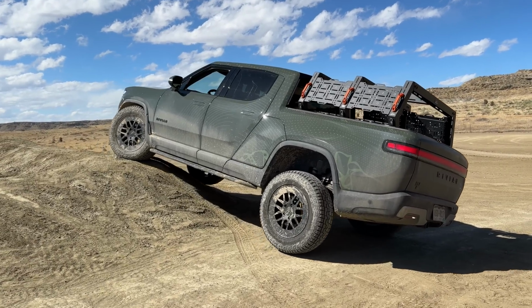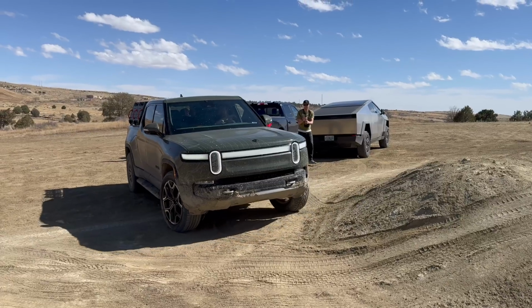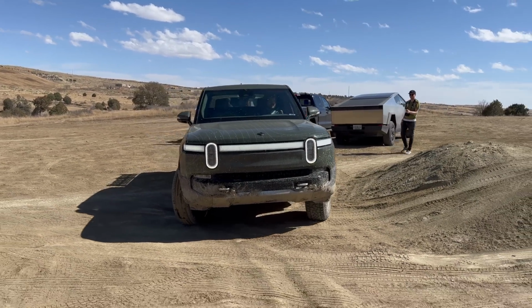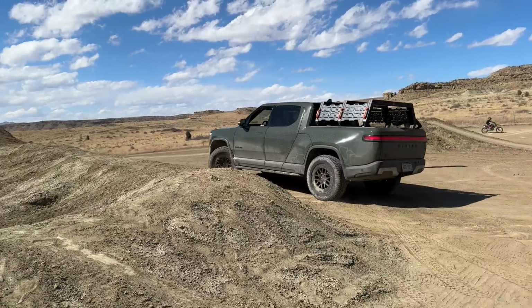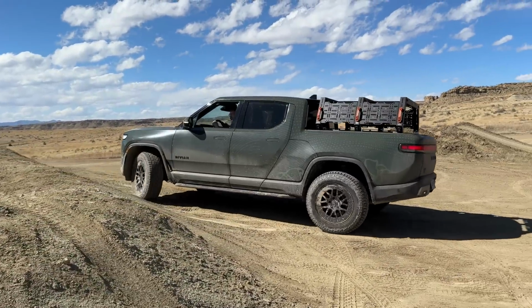It just needs, I think, a way to lock the left and right motors together for stall torque when you're really stuck, to just bump it up over a stuck obstacle. As long as you're not stuck though, this does feel like a pretty damn good way of doing things. My personal preference for consistency though is just having a physical locking differential.